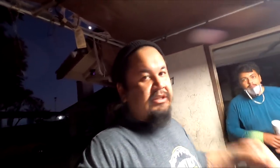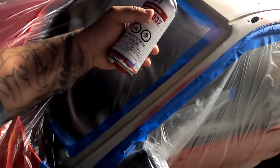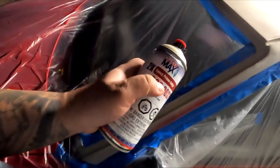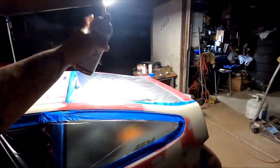We're literally back the next day and we lost a ton of daylight. Last night me and Leo finished up at about two o'clock, got ready to go to sleep, and woke up a little bit late today because we were both tired from all the prep. Leo came out here started sanding the car with the final grits, and then we had to take off to the store to go get some material. We got some epoxy primer — I was told you can use epoxy primer underneath the channel so that way the window guy's primer would adhere to it, and then the urethane will adhere to his primer. So this whole entire channel has been layered up with about three coats of epoxy primer in beige.